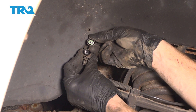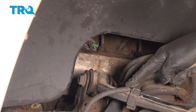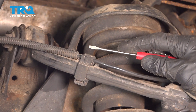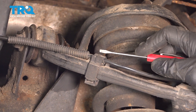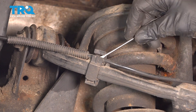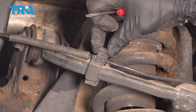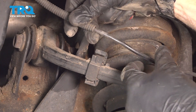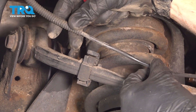This one looks fine. Let's follow the wire down to the upper control arm. To remove this from its locking clip, we'll use a small pocket screwdriver. Come right in between this clip and gently pry to separate it. Once you have that up, continue on to removing the ABS wire from the clip itself and give that a quick inspection.